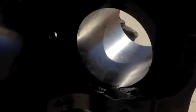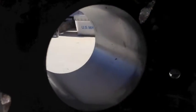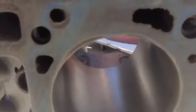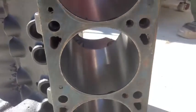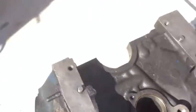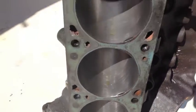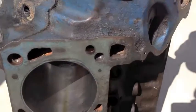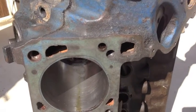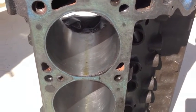Hot tank first. So we want to hot tank it, and it's in capable hands. I'm going to do an extreme Mustang Medic close-up on this block. There are the cylinder walls, and you can see the 60 over — there's just nowhere else to go with cutting. There's no extra metal on this; this is as big as they get. There are the inside of your cylinders on your block, Mr. Pizza Guy. She's gonna get hot tank next. All these water passages were plugged. The water passages were plugged — she would have been running very hot very quickly.